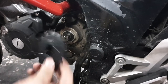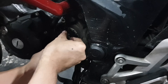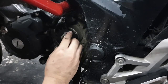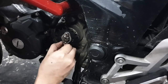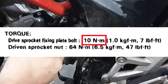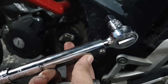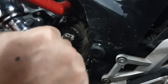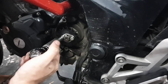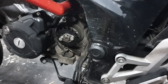Installing it is just the reverse. Slide it back in like so, then put the locking plate back on and seat it back in. Then put back the two bolts. Now the manual says to torque these to 10 Nm. My small torque wrench here doesn't even go that low — the minimum torque it can read is only 13 Nm, so I'll go with that. If you're doing this by hand, just make sure don't tighten it so much because you can snap the bolt. That was a bit scary.